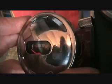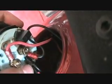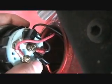And in case you didn't take a picture, here's what we've got. It's a fuel gauge. Flip it around. Left side there's a red wire, in the middle there's 2 black wires, and on the right here there's an orange wire. So you just torque them down and cross your fingers, fill it up with gas, and see if we have a leak. And the little washers that are on there, the little spiky washer, goes above the connector. So it goes connector, spiky washer, and then nut on top of that.